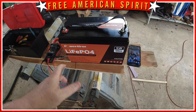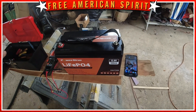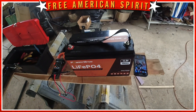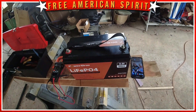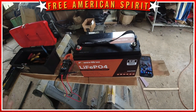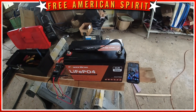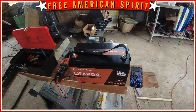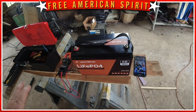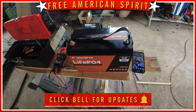When I put these in, I'll have an AB switch with leads coming off each battery. If I hook them in 12 volt, I can just turn that switch off and charge them separately like they suggest, even though you may be able to charge them together. I'm just going to do what the company tells me. If it's in series at 24 volts, I would have to use a different charger. I won't know until I get my trolling motor and decide whether I'm going 12 or 24 volts, but when I do, I'll show you what chargers I got.